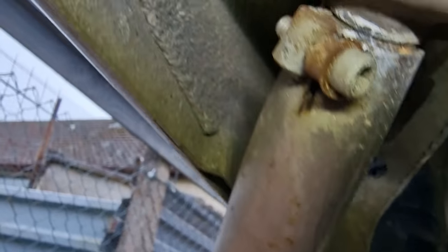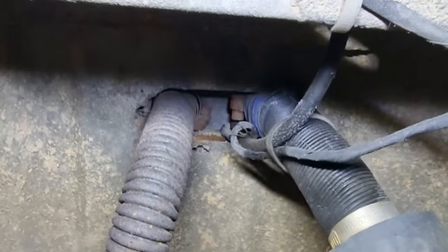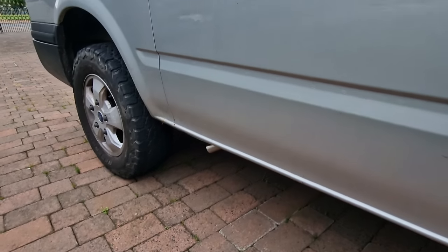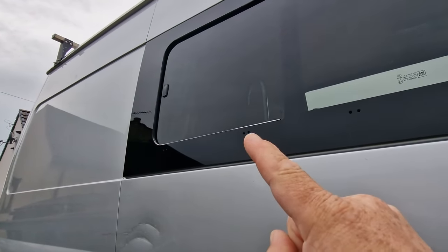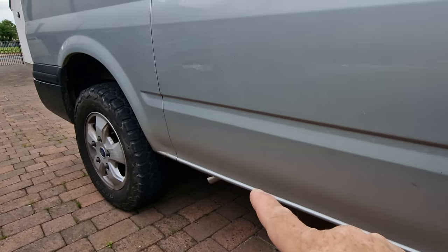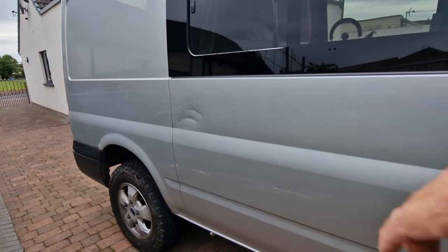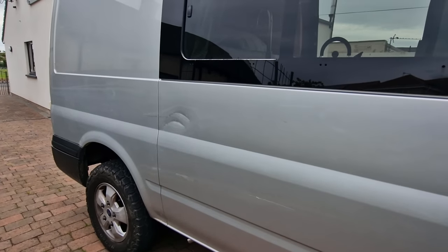The minor fix was a little extension to take the gas away and it's working for now, but they're still getting smells of fumes — and on inspection that big gaping hole is the reason why. There's also another issue: that's the exhaust for the night heater, and right there is a window. You really shouldn't be fitting things directly under the window. If there's no wind, fumes are just going to come straight up and straight through that window.